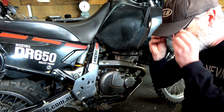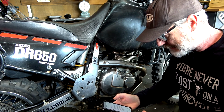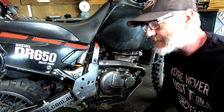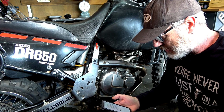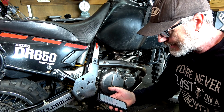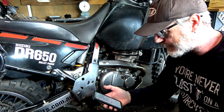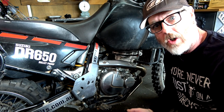thankfully for you guys out there that are always commenting and giving me heads up on things and different ways of doing it, I just want to read out one of the guys that said it. This is Some for Seb. They've got a YouTube channel, they're from Canada, long time watchers. That's Samantha and Sebastian. And what they've said is: "I think Seb's done a great job on both the front and rear install. Make sure to empty some of that fluid in the rear reservoir down to the upper limit line at least. When you ride and the brake system heats up, the fluid expands with heat. Therefore, it will need a bit of room so it doesn't overflow." Brilliant, thank you, and quite a few of the guys said it, so thanks.